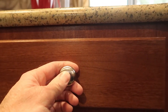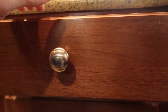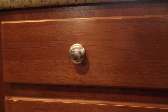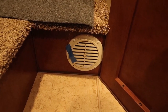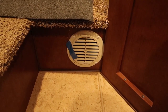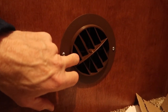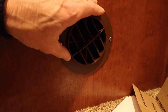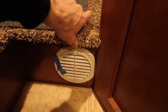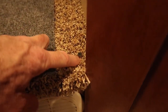All of your door knobs and cabinet pulls tend to work loose after a while, especially the drawer pulls. So one of the first things I always do is pull the screw out from the back on the inside and put a little bit of blue thread lock compound on it. Down there is the basement circulation fan — it blows warm air down into the basement area when the furnace is running. That vent is new; the vent that was originally there was undersized. The fan that was in there was also extremely noisy.